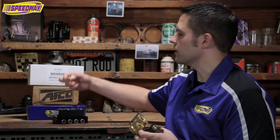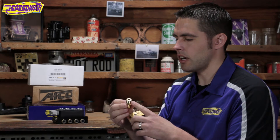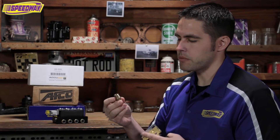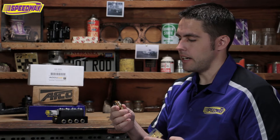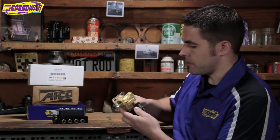Like I said, this is a nice piece. I actually just put this on my 1964 Impala when I was putting an air ride kit on it, and it's worked great. A couple tips when putting in fittings: you can use plumber's tape or you can use a thread sealer. I first started out with plumber's tape and about half of what I did didn't seal correctly. I aired up the car, and the next morning I came out to the garage and the car was sitting at an angle. So I ended up spending half my day pulling all the fittings out, put thread sealer on them, and that fixed the problem. But great piece from AVS.